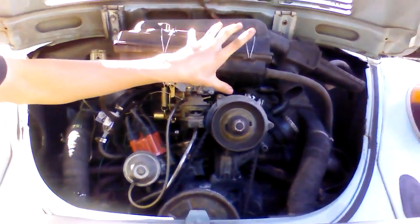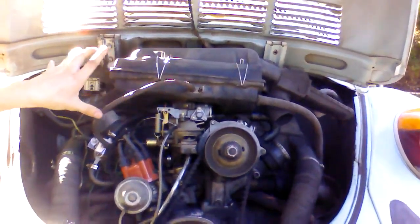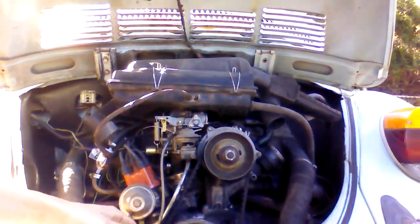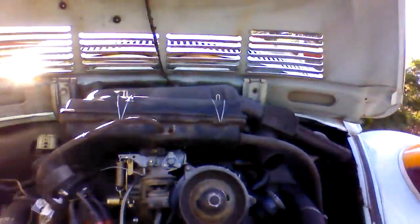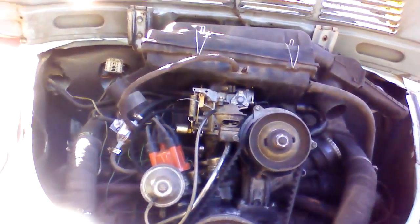Turbo exhaust housing going to be sitting over here with the downpipe going down. Intake going to be sitting here with my carburetor sitting on top right there, and piping coming through to the exhaust housing should all still fit underneath if I can get it around my alternator. Should still fit all underneath the hood. Yep. That's a little update on that.